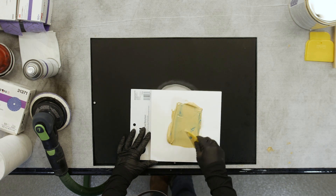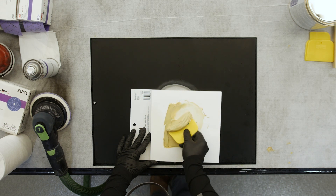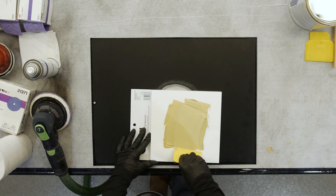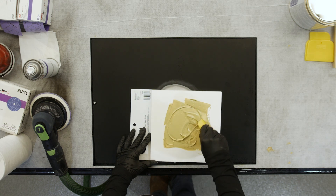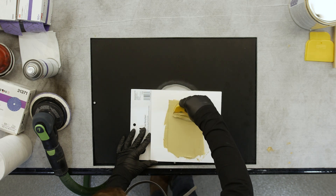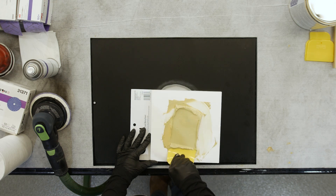There's a variety of techniques when it comes to mixing filler, but one of the most important is going to be to fold and flatten the body filler, as opposed to stirring it, which can introduce air. In the event that we were to stir the body filler, you can see that when we go to spread it, we've introduced lots of different air pockets into the mix. That's why it's so important to fold and flatten.